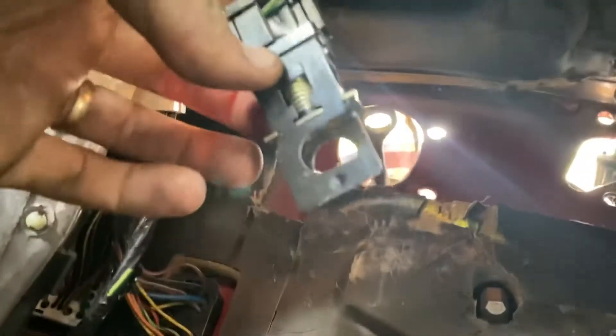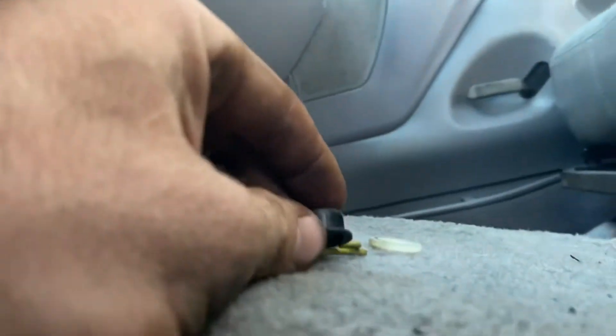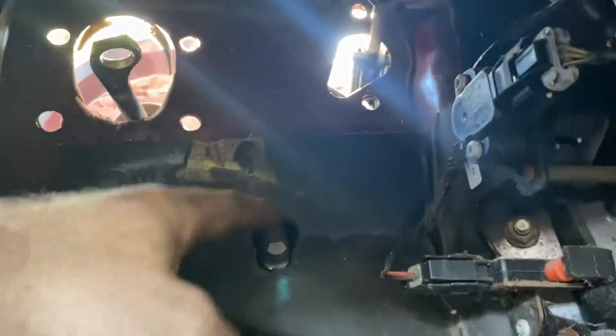Under the truck there's some other stuff you're gonna have to deal with. Whenever you take off your switch for the brake, there's gonna be these little bushings and a washer that's gonna fall off — make sure you find those. Then just push your steering rod all the way down in there; don't let it go too far, you don't want to go fishing for that.